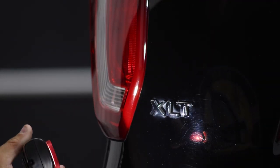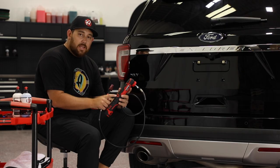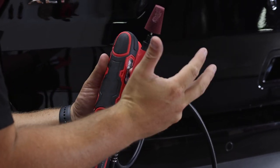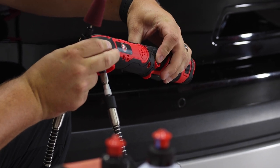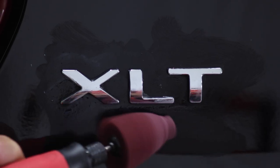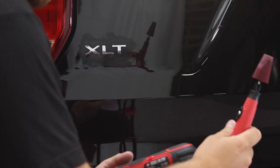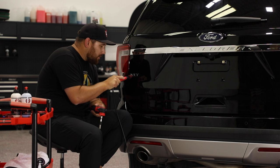We're going to show you the capabilities of this rotary attachment kit working on the nooks and crannies of a badge. Take some polish first — we always want to choose the least aggressive method first. This is set on setting one, the lowest speed. With this being a rotary attachment, we do not recommend going above speed four. Turn the machine on and lock it in. One important tip: make sure to move quickly and keep moving so the energy doesn't stay in one place, which could potentially burn your paint.